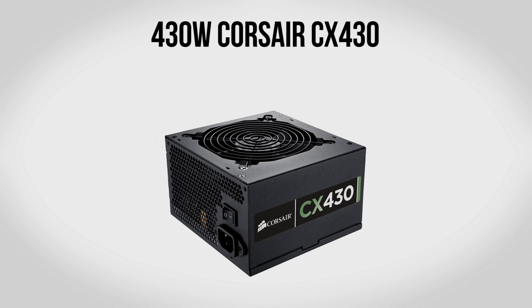For a power supply we're going to be using a 430 watt Corsair CX430. The cool thing about this is that it's a cheap power supply without being cheaply made — there's a big difference there. You're going to get really nice performance and efficiency thanks to the 80 Plus Bronze rating, and it's also a little bit smaller than a normal sized ATX power supply. That matters because the Prodigy has a somewhat cramped area for the power supply, so that little bit of extra space means more room to route all your cables. For only $40 this is going to be perfect.